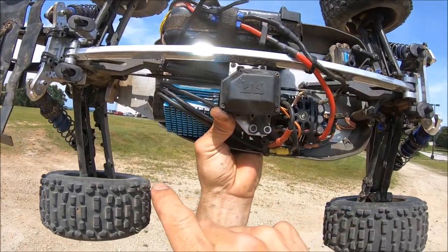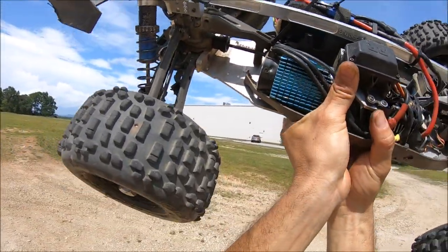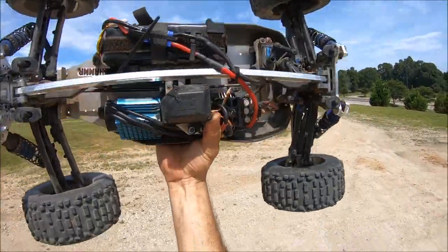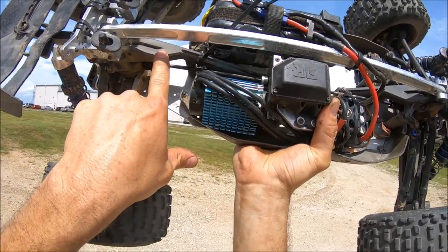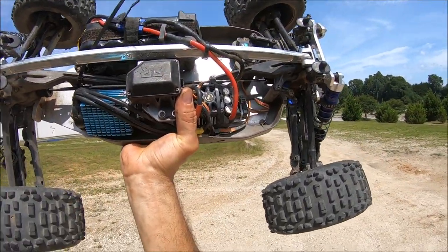So, which is causing other issues. It caused my rear diff case to separate from the back of the chassis right there, because there's no support right there, so everything just lifts up. The tower-to-tower brace has a little bit of a bow in it from all this right here breaking, so I need to get an upgraded aluminum one for this, and then I should solve all the issues there and get everything locked in and nice and snug.